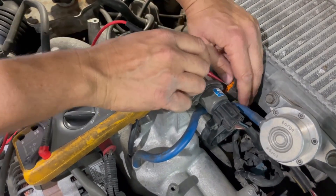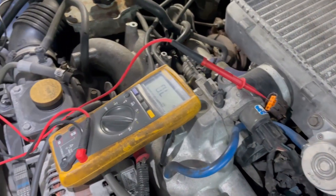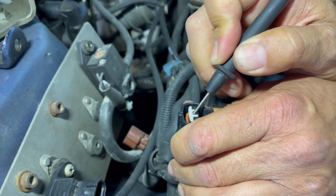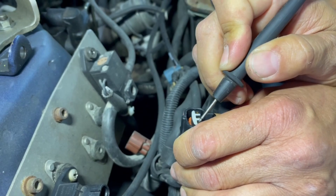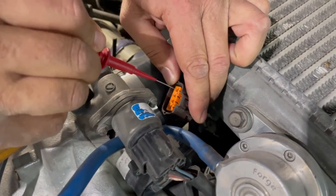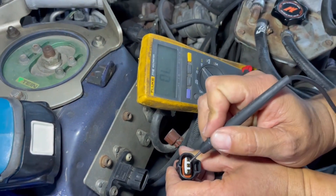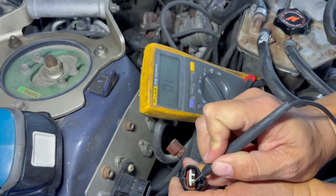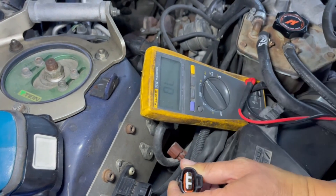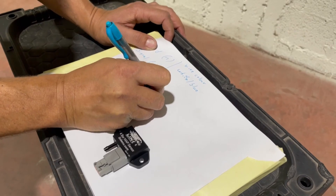To find the sensor supply wire, we go over to the next pin in our TPS connector with the multimeter still on continuity mode and see if we have continuity in the other pins on the MAP sensor connector. We can see that we don't, so we move to the next pin, check the MAP sensor connector again, and here we can see that we do have continuity. We'll confirm it once more and document the wire color in our diagram.